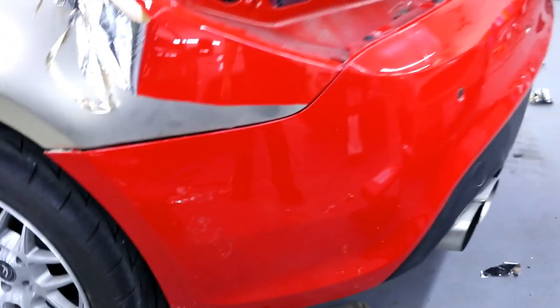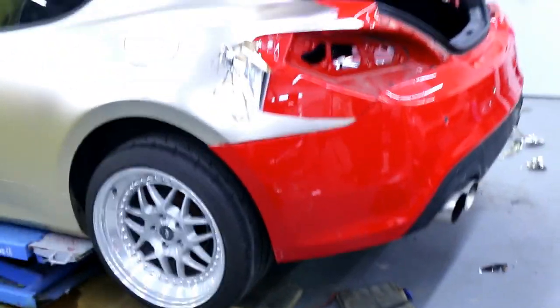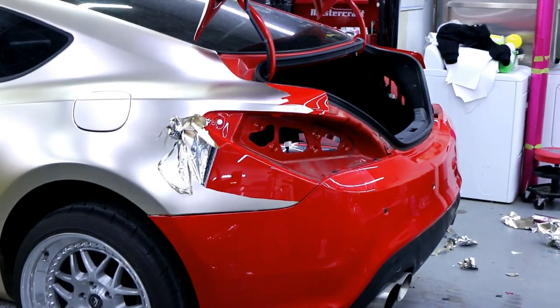The bumper is a rubber bumper so I could unwrap it properly, but if you go to wrap over that and reposition your vinyl, it's going to lift the clear coat or paint right off the car and cause issues. So I'm going to show you an example of how that might happen right now - I'm going to grab a little bit of vinyl.